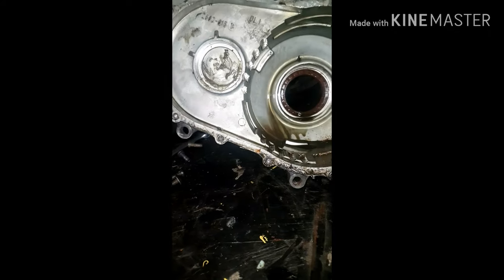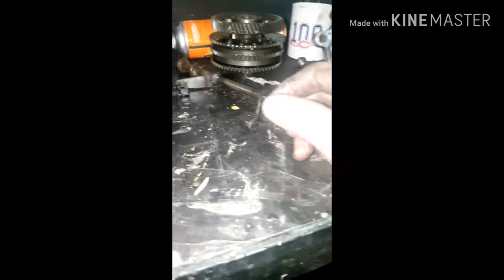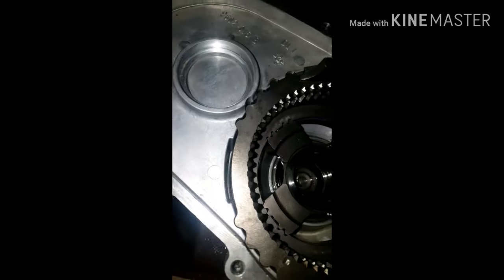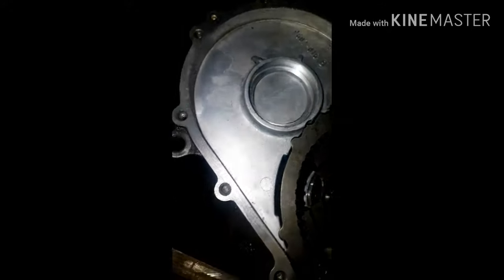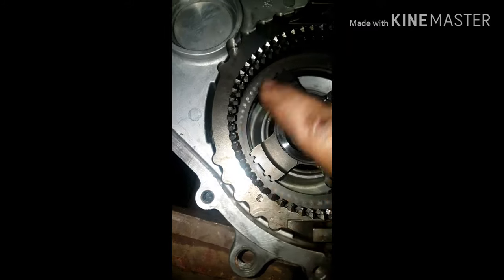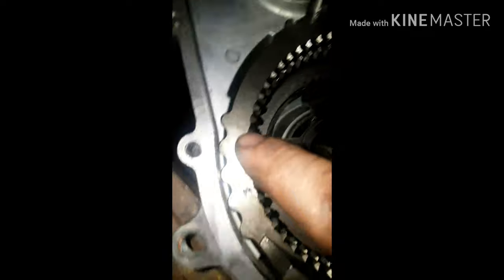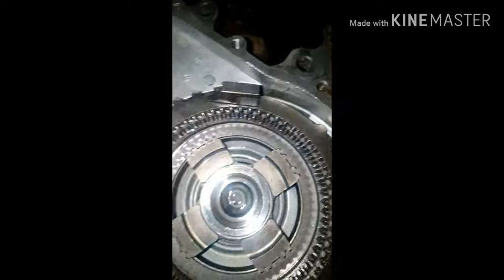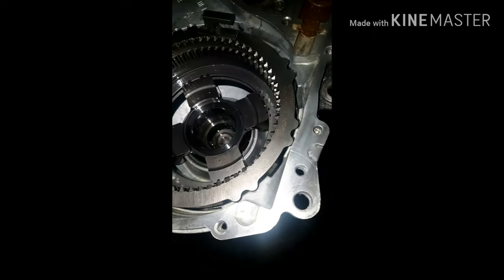So what I'm going to do is clean all this out, clean the cover, everything. The reassembly is exactly the same. Alright, here it is — getting ready to reinstall. I've washed everything, took a wire wheel, cleaned all the mating surfaces so when I put the silicone everything's nice and sealed. For this piece here, as you can see it's notched certain ways — on the top you have five notches, here you have five, and then you have your two and two. It only fits one way, so that your reverse rod and everything sits in place correctly.